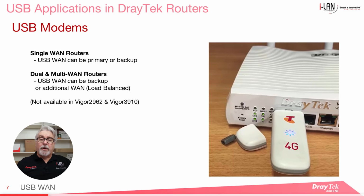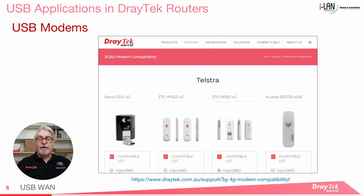Just a note that the USB WAN function is not available in the current firmware release for the Vigor 2962 and Vigor 3910 routers. A list of supported 3G and 4G USB modems is available on our support webpage at the link shown here, which I'll include in the description below.